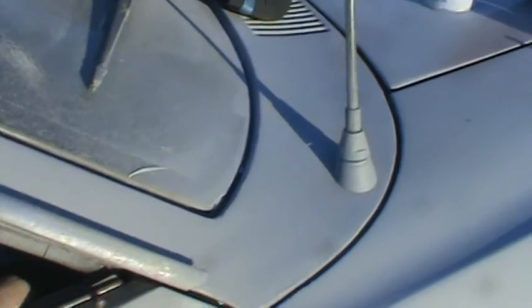And there it is, all primered up. I can see I got some little pinholes that I need to fill. A few pinholes, but looks good. The crack is bigger than I like, but good enough. And the door's opening easily, not touching anywhere. So now I can see what I need to do to glaze it, but I'll let this primer dry.